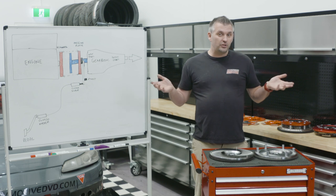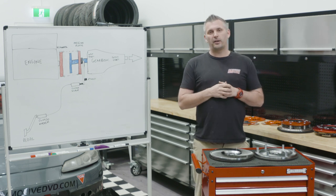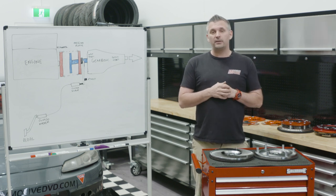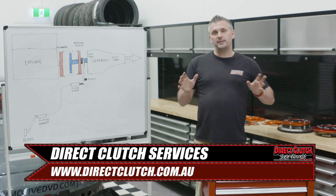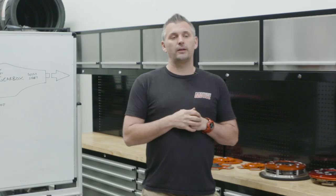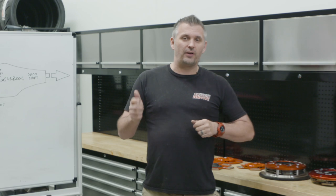So there's a lot to them. You've got to choose based on the application. If you have a time attack car or circuit car and you don't care about drivability, make the flywheel and entire assembly as light as possible. But if you have a road car, you've still got to say to yourself you want it to drive nice. You can go slightly lighter than factory — a flywheel on its own can be pretty heavy and you can save a few kilos — but don't go too light. Whenever we're speccing a twin-plate clutch for one of our cars, we speak to the guys from Direct Clutch Services and say this is the power we're making, this is the way we're going to drive it. A recent example was they offered us a lightweight clutch for our R33 GTR that we're going to use for circuit, and I said no — I still want to drive it on the road and it will do some drag launches. Give me the same clutch as our R32 GTR that we have experience with. Lighter is definitely not always better.